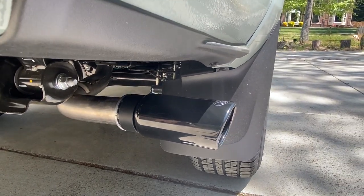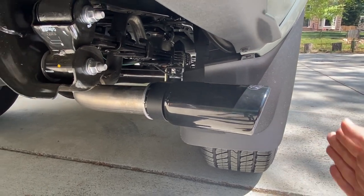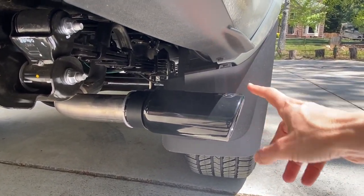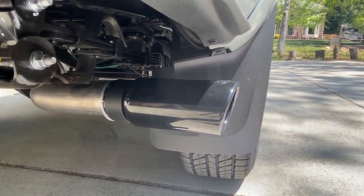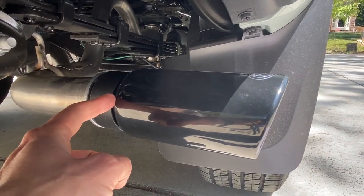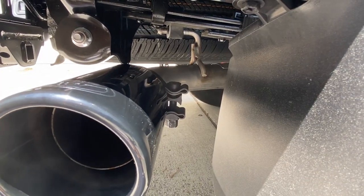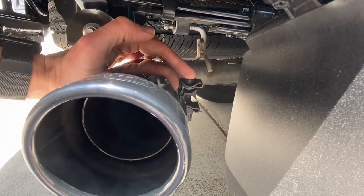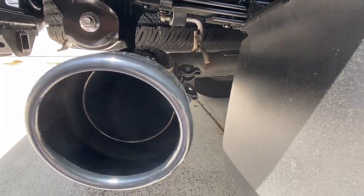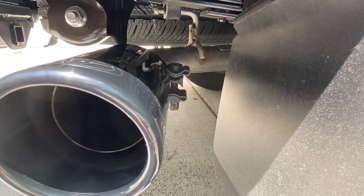You need to figure out what depth you want to mount this at. You can push it in a little bit, but I kind of want to go flush with the body. You want to show off your fancy exhaust tip, so I like this position at the maxed-out point — there's a bump-out at this location where the collars stop. Take your 15 millimeter socket and ratchet, tighten things down, and that finalizes the installation.